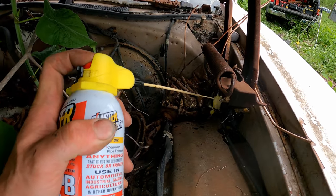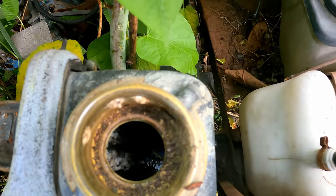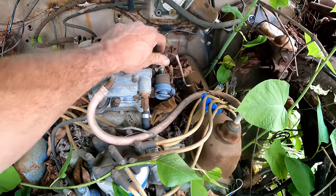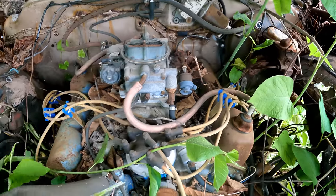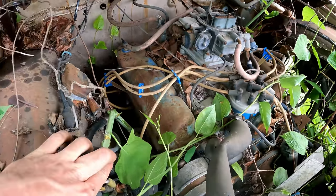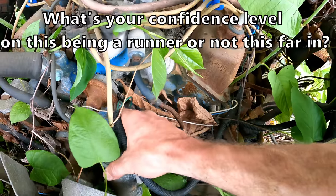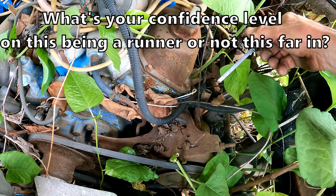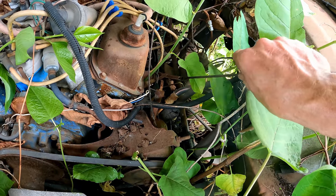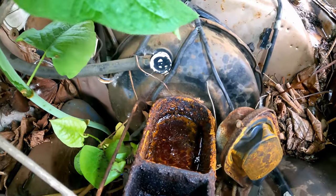Rad is empty and really corroded looking — that's probably one of the more corroded rads I've seen. Got some stuff growing in it. Holley four-barrel on it with seized-up linkage — we'll hit all this stuff with PB while we're at it. This does look like a Cleveland to me, instead of a Windsor. It's got an Edelbrock intake on it, Super Stock wires. Ignition coil is kind of dangling in the wind. Power steering actually has something on the bottom of the stick. Motor oil is up to level and not that dirty looking — that's usually a good indicator of how long something's sat. I'd say about 20 years.